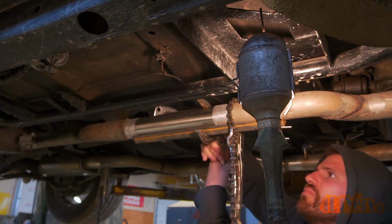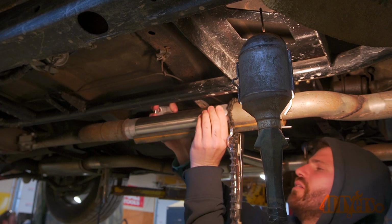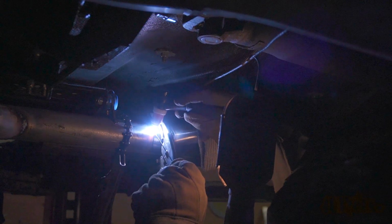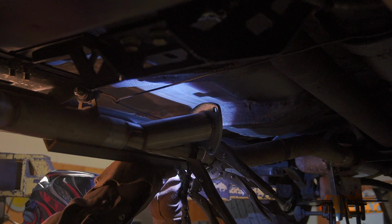The Y was angled up slightly to prevent any water or moisture pooling inside, which may cause issues for the electric butterfly motor in the future. The pipe was tack welded into place to hold its position. Then the pipe was fully welded just like before.